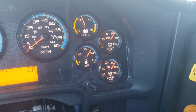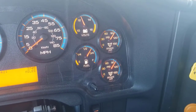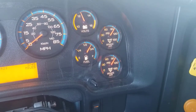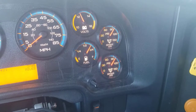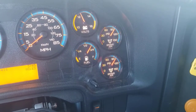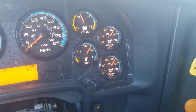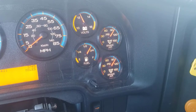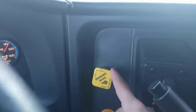During this minute it's going to be awkward silence, so use that time to tell them what you're going to do next. You're timing this for a minute — the bus shouldn't lose any more than two to three PSI. After that minute, you're going to start pumping your brake pedal. As the pressure drops, when it reaches 60 PSI, the low pressure light and alarm should come on, and as you continue to pump down between 20 and 40 PSI, the parking brake should pop back out.